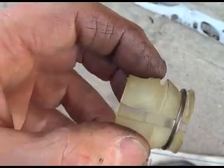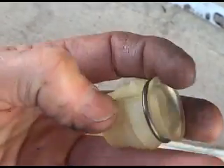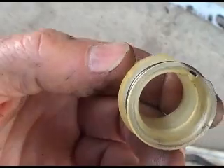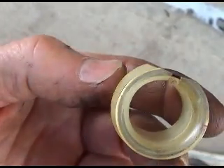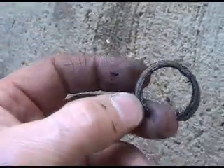This groove is what goes inside the tunnel, and what you'll need to do is collapse this down, get it to expand, and then reach down there with a pair of channel locks or a wire — whatever you can come up with. That's the challenging part: working through that little hole, getting the shift rod to start going in there, and just inch it along. Along the front of the car there's an inspection plate, but because this is a Baja I can't get it all the way out, but I was able to get it stuck far enough forward. Here's a piece of the old plastic — so this has been done once before. Here's one that got cut in half, so that gives you an idea of what happens.